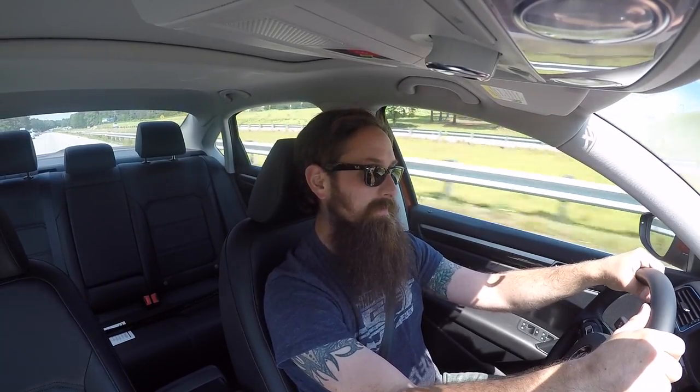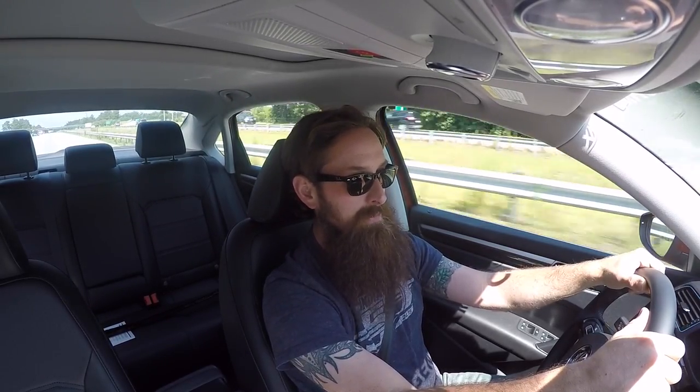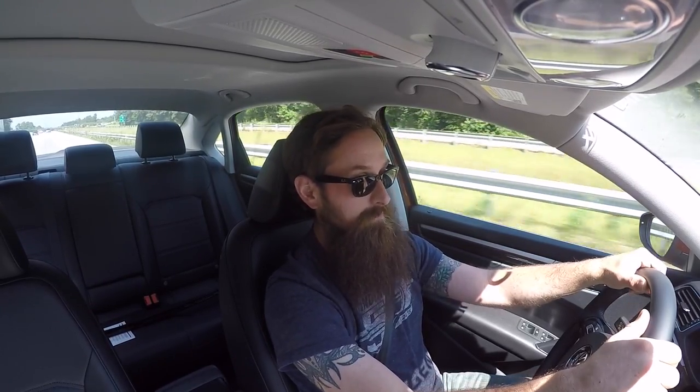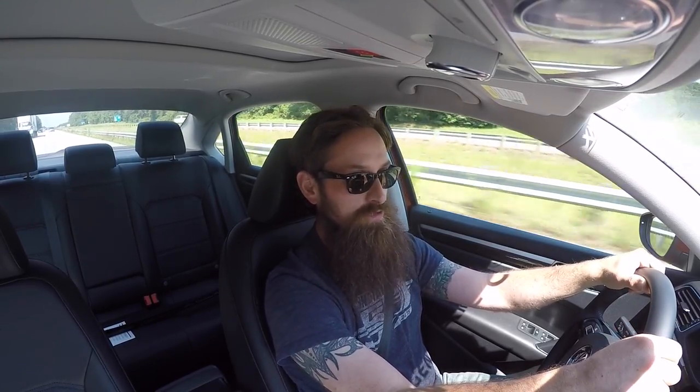That's what I do when I drive a manual transmission car. Phil, I'm not beating up on you — that's a great question. A lot of people do rest their foot on the clutch pedal. But you wouldn't rest your foot on the brake pedal in the free-play zone, because you could activate your brake lights or even drag your brakes. Another thing: your cruise control probably won't work because manual transmission cars have a switch so the ECM knows you're pushing the clutch, and that'll deactivate the cruise control.